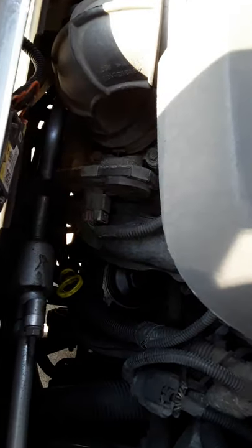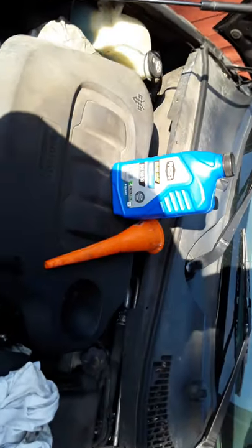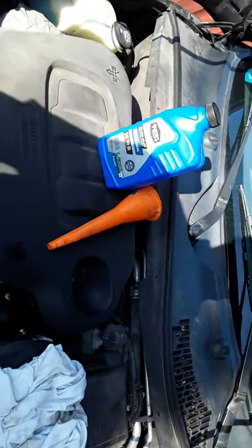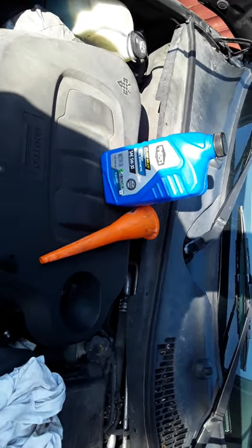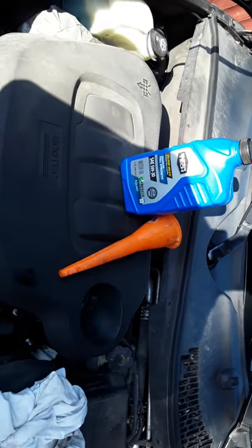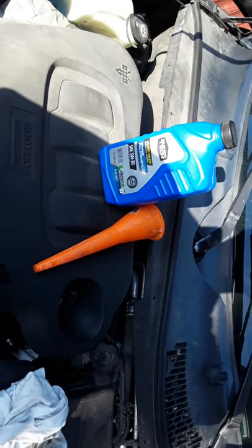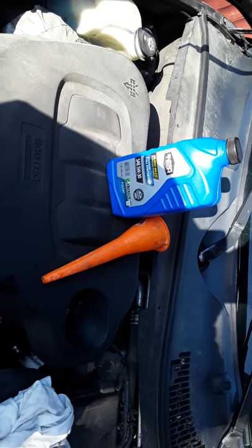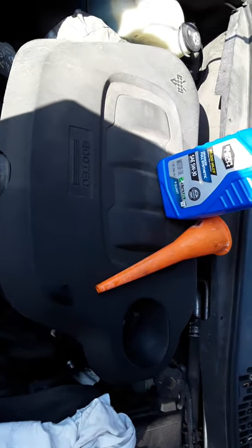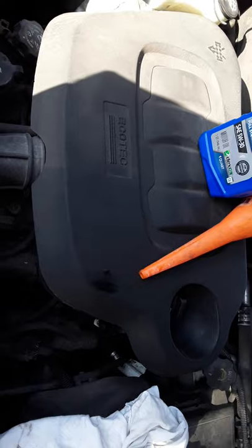The main thing is to check your oil when it's cool. A lot of people debate whether to check it warm, but when the engine is warm the oil is up in the heads, in the block — it's not in the pan, so you won't get an accurate reading. I've actually tested this: right after running the car it said I was about two quarts down, but four or five hours later the car was only about half a quart down — meaning a quart and a half had drained back into the pan in the interim.